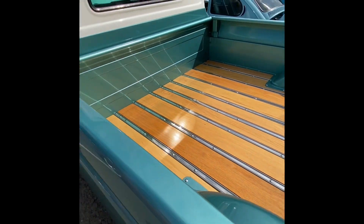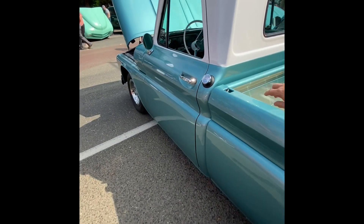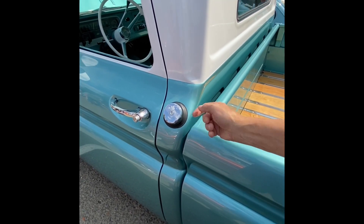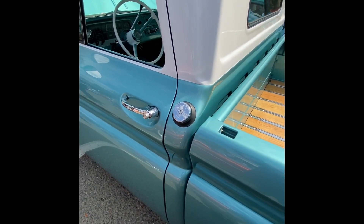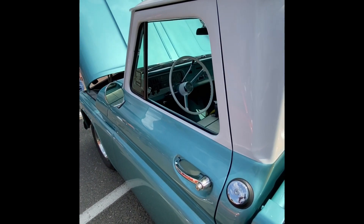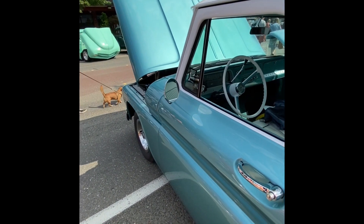This one here has a locking cap. I'm going to put a kill switch in there for the engine — just around the coil — and then I'll be able to take the cap off, so that nobody can just get in there and start it and take it.